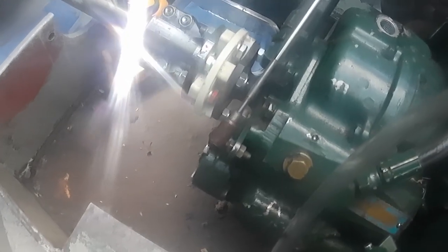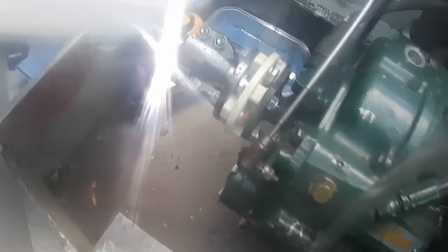There are quite a lot of people who don't go through this process purely because they can't get at the bottom of the gearbox — accessibility is too poor. I'm quite fortunate in that I can, but it's not great as you'll see. Those that can't will just use a Pela pump, just pop a tube in the top to suck the oil out rather than going through this process.